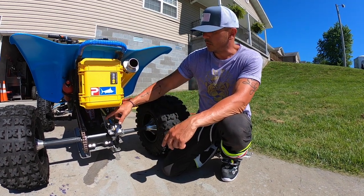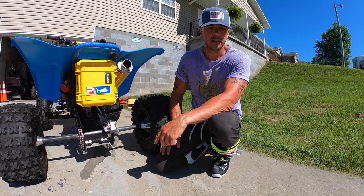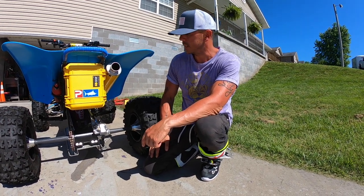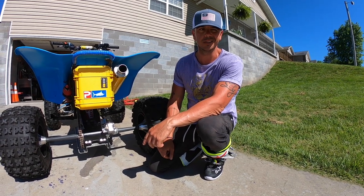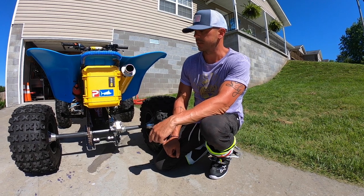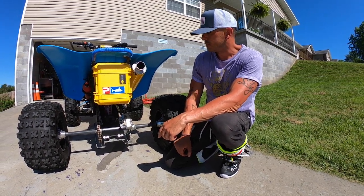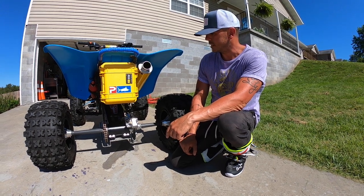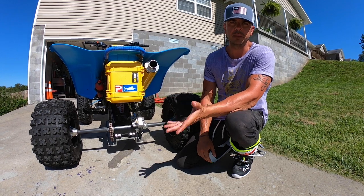While we were in that process, we went ahead and took the rear end apart and replaced the rear carrier bearings. Discovered on this that the rear carrier is a Lone Star, and so if you've got a Lone Star rear carrier, you're going to need the wider aftermarket Lone Star or All Balls rear carrier bearings. We went with All Balls, and the reviews are all over the planet. Maybe you love them, maybe you hate them.